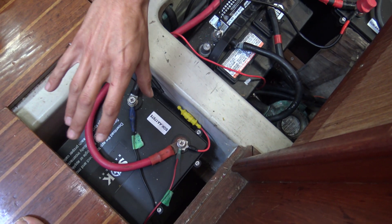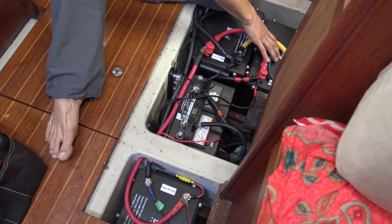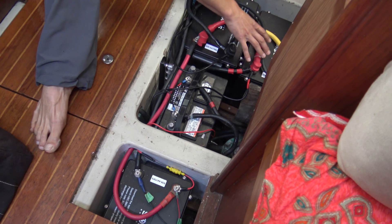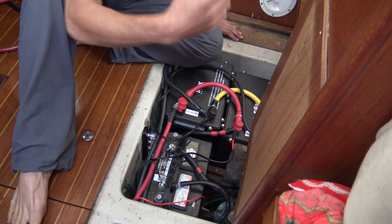I can realize: okay, well this battery over here is definitely not being charged as much. The battery with the longest cables that connects to my other bank over there is barely pulling any juice out of it. So these ones are cycling a lot and this one isn't cycling at all. Ignore this one — it's just our starter battery, we'll sort that one out later. The power wants to come out of the easiest spot, which is these ones, so it's pulling from these big beefy wires going straight to our DC panel.